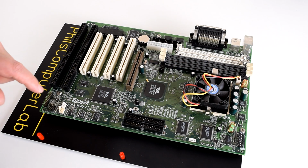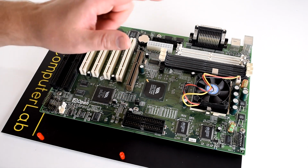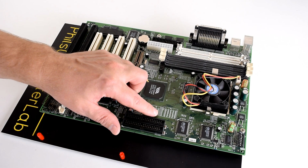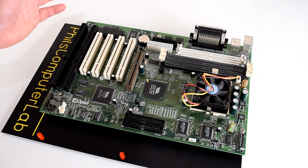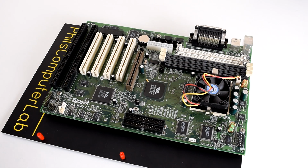Then we have the CPU multiplier, the ratio, set that to 5.5 to overclock the processor to 550 MHz. And then the last setting is for the voltage. Seeing this is a 1.6 volt rated processor, I settled for 2.0 volts. And if I do get any stability issues, I'm just gonna raise the voltage a little bit, but I believe 2.0 volt should do the trick.